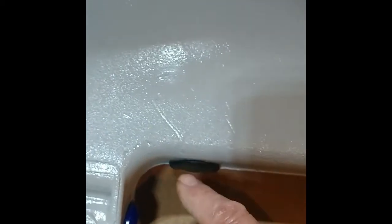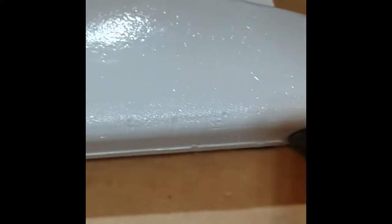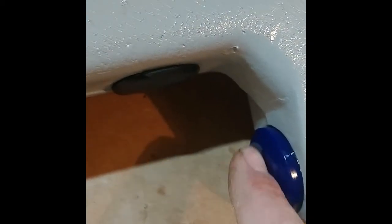See, on the second arm, these plugs went in a lot easier. I did notice that the holes were actually round. The casting on the other one, they almost look like D holes, so that's probably why these went in a lot easier. I used plenty of soap, and yeah, they went in quite easy. This other thing is I put silicone grease inside of these bushing pins or whatever, just so that it can pivot easily. This car will never see water as long as I own it, so I'm not really worried about it rusting.